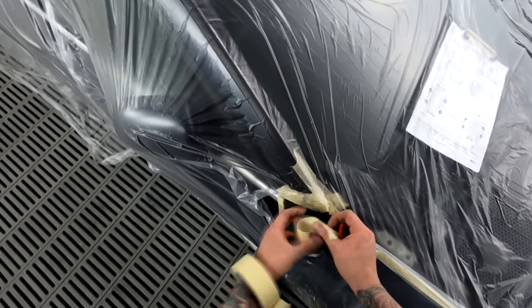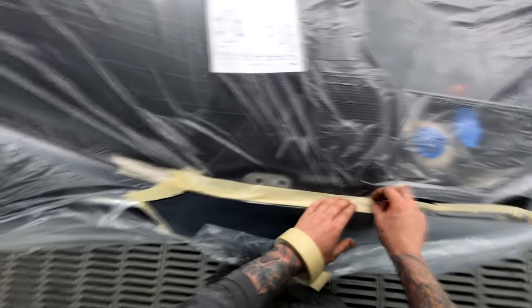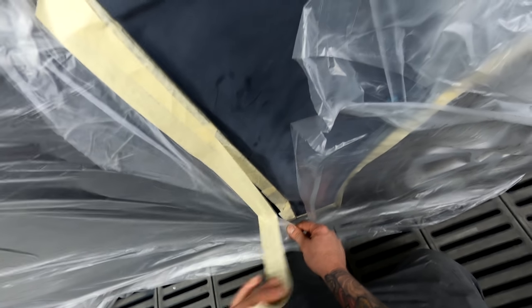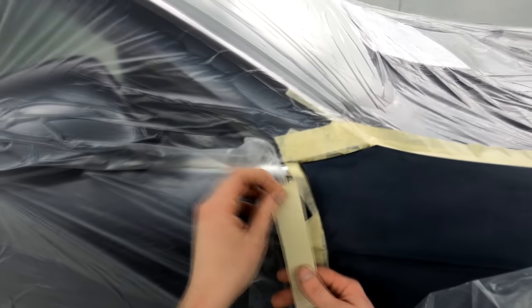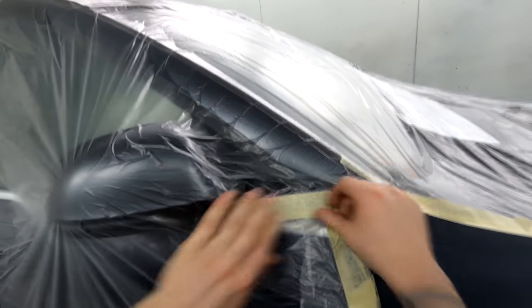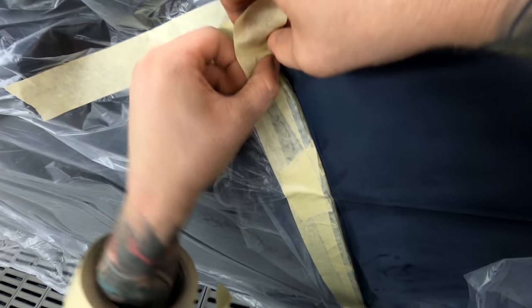Also on that one, I think I used the ANI F160 1.3, which really pounds the paint on. So I probably should have gone the 1.2 with the F160. That's the full-size ANI gun. Certain guns do spray differently, even though you might say it's all 1.3. Some do put more material on, even though they're the same tip size. So this FLG5 in 1.3 really does get a nice fine finish, but the ANI with the 1.3 will put a lot more on.